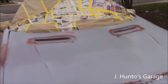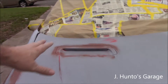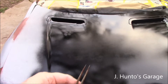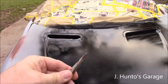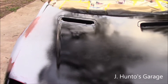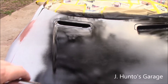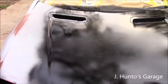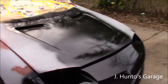I'm going to go ahead and spray some black on the hood. Not sure exactly what I'm going to do yet, but I'm going to spray this whole entire center section and do something with it. When you're going to paint outside, you need a pair of tweezers. I've had these forever — they're old and rusty, but they really come in handy. If you get a little bug or a little piece of dust in the paint while it's still wet, you can very carefully pick it out and then cover that with the next coat. Nobody will ever know, and it's something you don't have to go back and fix later.